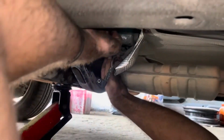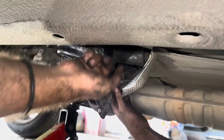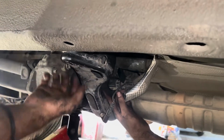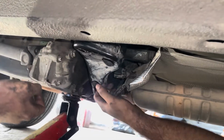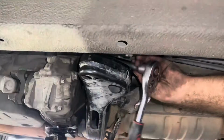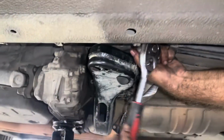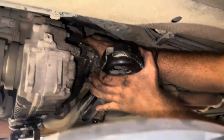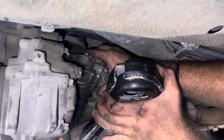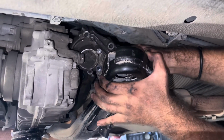The tab of the connector is on the bottom here. All we gotta do is press it in, as you can see, and pull the plug out. Now everything electrically is disconnected. All I have to do now is remove the one bolt that we left in to hold it in place. So now that we got everything unbolted and disconnected, we're gonna pull the actuator motor from the transfer case just like that, and then fish it from the side of the cross member.